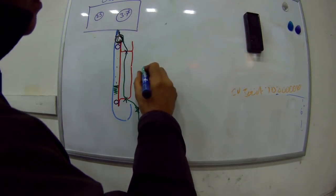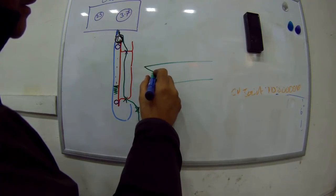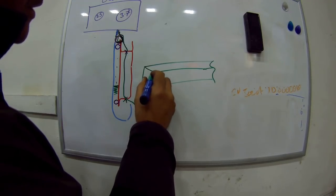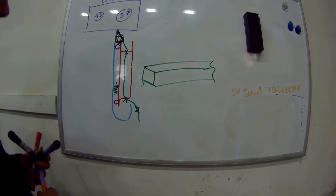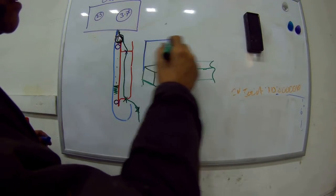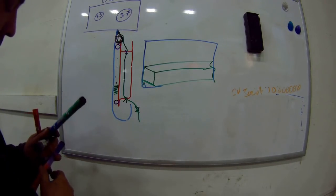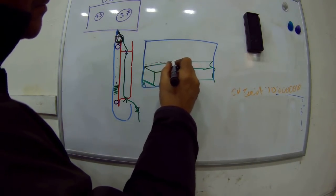And if you look at it along the side, like the box section... How do we do a box section? Yeah, do it like this, look. There's a box section. Yeah, that's sort of what it would look like. Actually, it wouldn't be that bit there. It would be across there like that. If you've got your door skin, which would be fastened to that frame, and again, it's crimped round the bottom, then putting a simple mastic bead on the top of here will help tremendously.